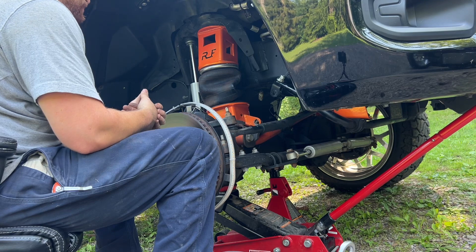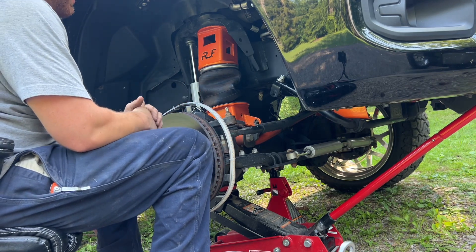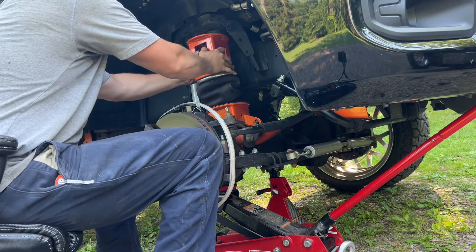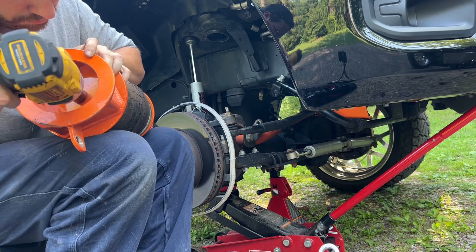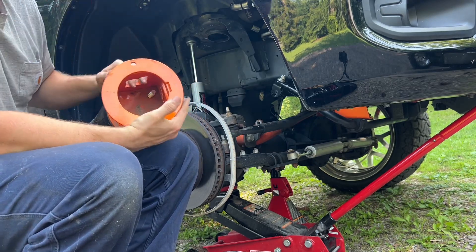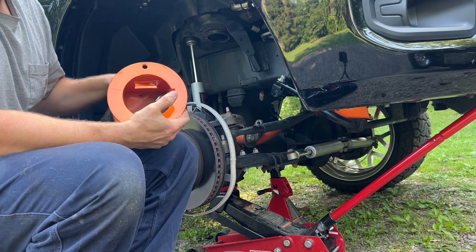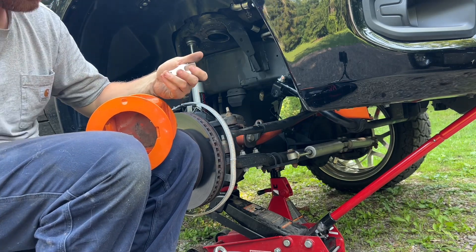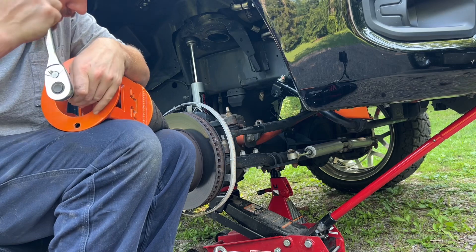At this point we're ready to take the bag out. We're going to take these mounts off and I'll show you where the tear is so we can get an idea of what caused it and avoid it again. This nut in here is kind of awkward — there's a lot of dirt — but I have a crow's foot for this one. It's a one-and-an-eighth, so I have this specific one for the job. Just get it loose and spin the rest off by hand.